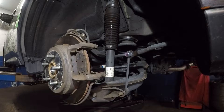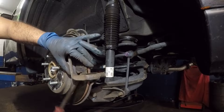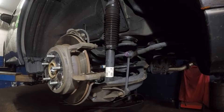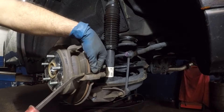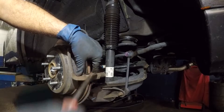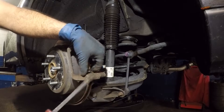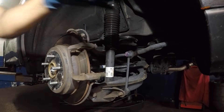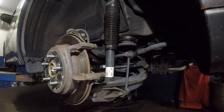Next, what you're gonna do is remove this brake pad. I'm also gonna remove this little clip and this one right here — this is the hardware kit. You'll probably have a new one with your brake pads. Don't throw the old one away yet.